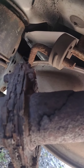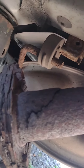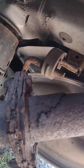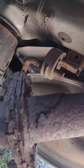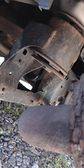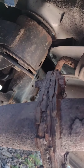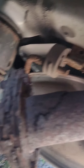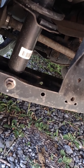It's hard to see it there, but there's a hole in the top, right in front of the flange there. This is the pipe that leads to the muffler. The muffler is in pretty good shape, and the only place I could see a hole is right on top here. When I put my hand up there, I could feel the exhaust coming out. I really don't want to have to pay to replace this entire thing because this flange seems to be intact and the gasket seems okay — otherwise you'd have to replace the entire muffler and go all the way up the pipe. I think it goes to a catalytic converter.